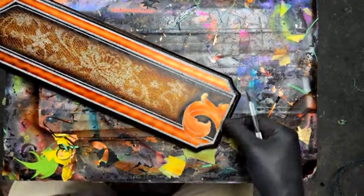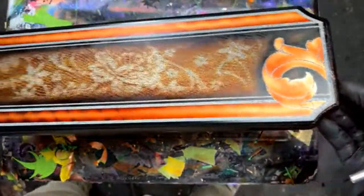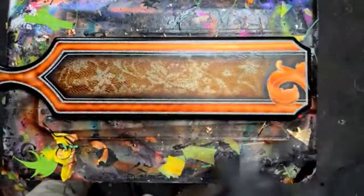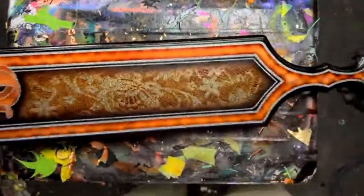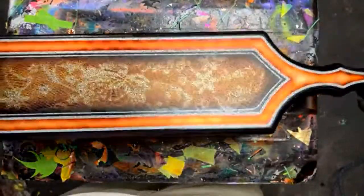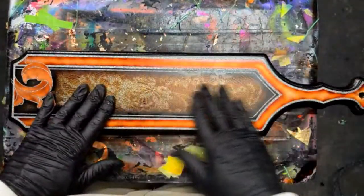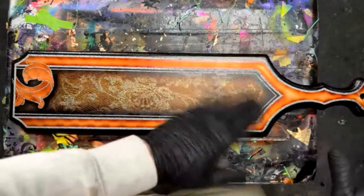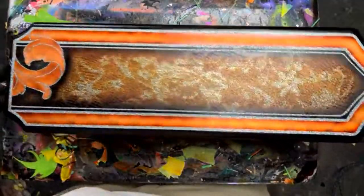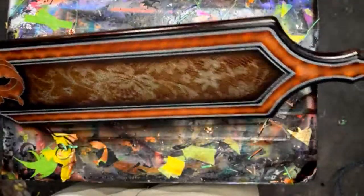Okay, there it is. All right, that wasn't too bad. All right, so next step after this, I would put maybe some glass cleaner, just a little bit, to get a little bit of the residue and stuff, then a tack rag, and then it's ready for 3 or 4 coats of 2K clear coat, and it's good to go for what it is.